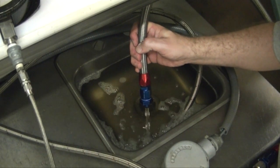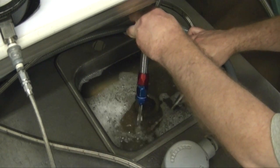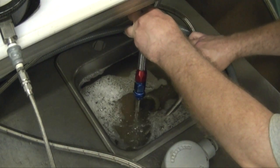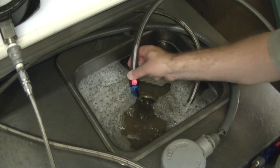After we induce the air, you will notice the pump reacting erratically. The regulator sees the pressure changing as the pump ingests the air bubbles. The regulator tries to control the pump enough to maintain the pressure, but with air in the line, it's nearly impossible.